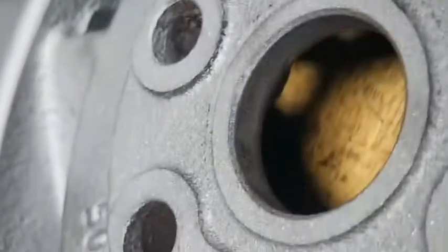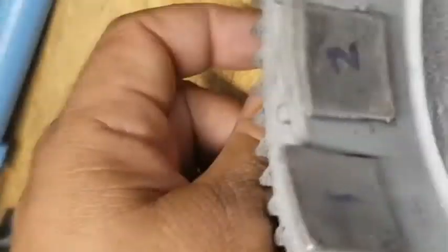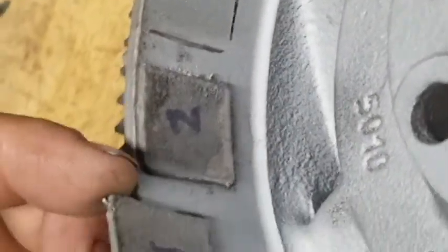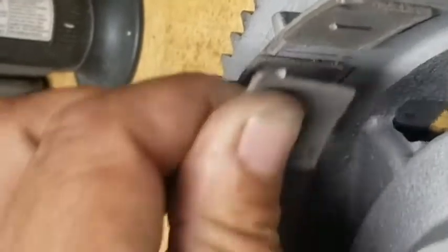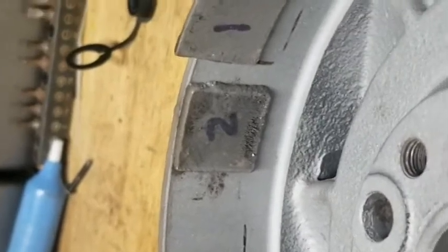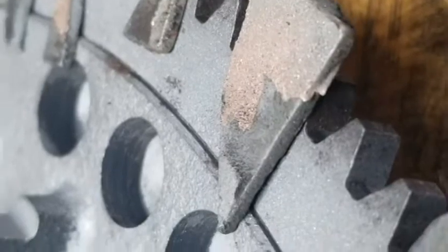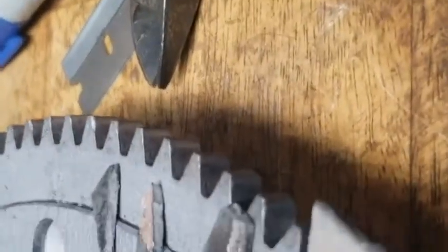Back here at the shop — there were a bunch of magnets that came loose, almost half of them. I believe there are 18 total. They are polarized — north and south — and I've numbered them one and two. They have to alternate: this repels, that repels, this attracts. Keep them spaced apart. Be careful — I had one in my hand, it flew out because it was attracted to another and it cracked. They will crack, so I'm going to epoxy it back together since it doesn't lose its magnetism.